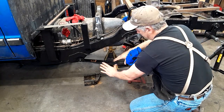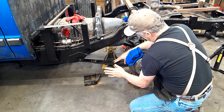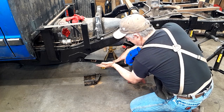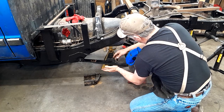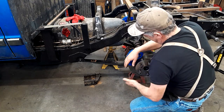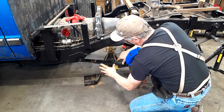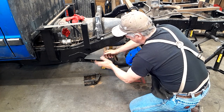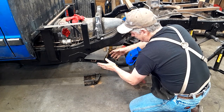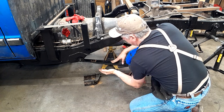Now, on a leaf spring suspension, this takes some imagination, but everybody knows about spring wrap-up. So you stomp your foot to the floor, it picks up the front of the pinion because you're applying force this way, you have an equal and opposite reaction this way, so your torque is wanting to fold the spring up. That's one thing. Everybody understands that the torque is wanting to fold the spring up.